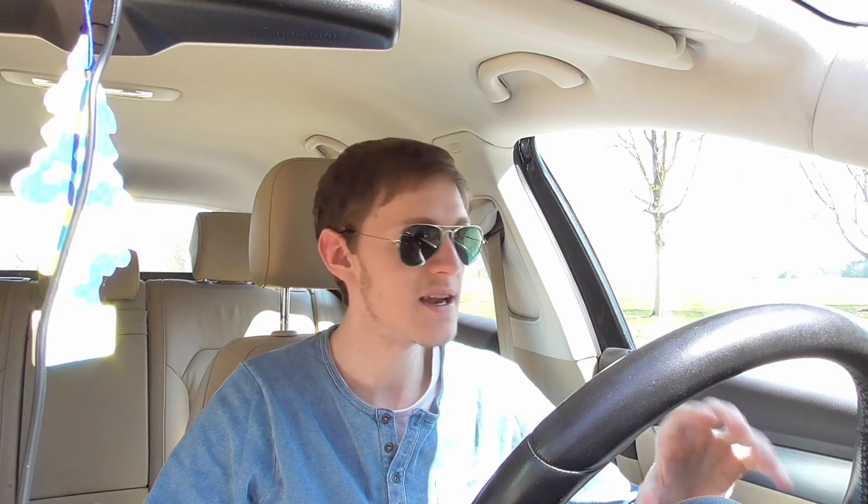You can still install an operating system, but you need another machine. What you basically have to do is install the operating system on a different Mac, onto the hard drive of the iMac. Then you swap that hard drive into the iMac and it should boot. That works from versions like 10.10, 10.11, 10.12, 10.13. On the natively supported ones you don't have to do anything special — you just install an operating system, or clone it, and it should boot up.